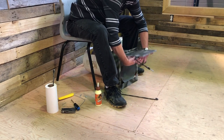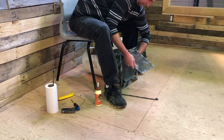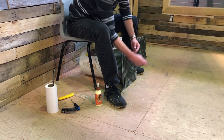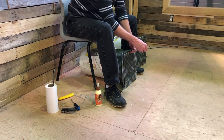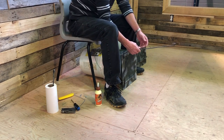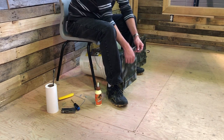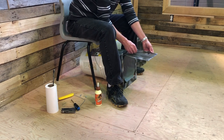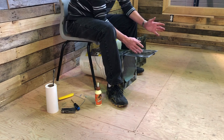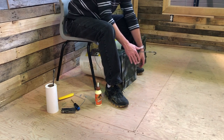Open the door and slide this in. Slide the threaded rod part out through the little gap in the top of the pail, then put this part back on. You know you've adjusted it properly when the pin sits at the back of the pail and just comes out a wee bit — that will hook the door. So when it's about that length, you know you have it about right.